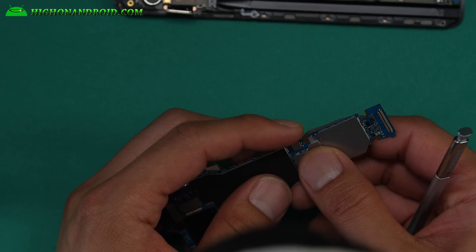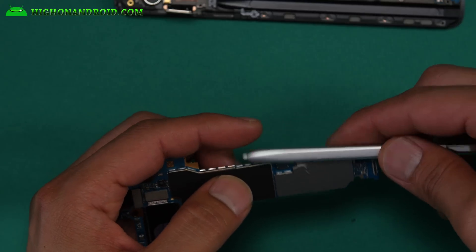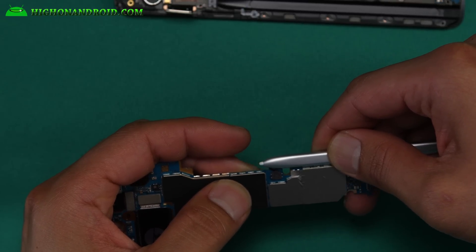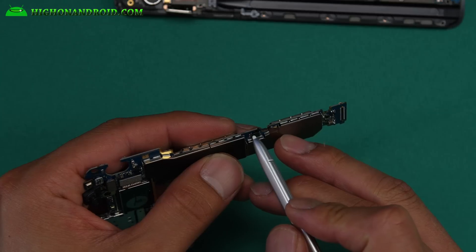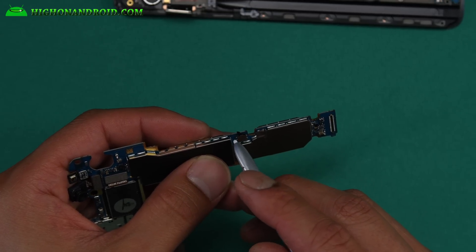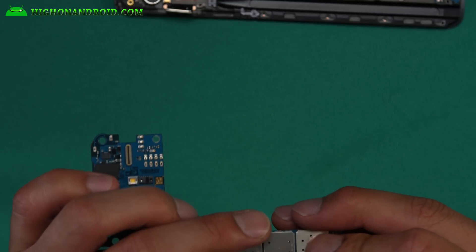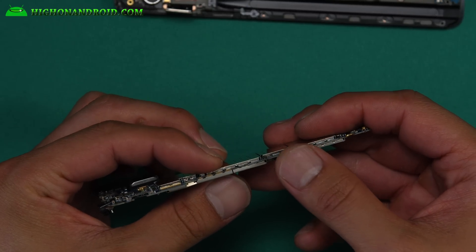This thing seems to be working, but when I have it inserted, it's supposed to hit that knob and pull it out, but it doesn't work. I'm pushing in — and when pulling out, it should pull all the way back, but it gets stuck in the middle. An easy fix would be to reattach that knob using super glue. It's not supposed to go all the way down past this point. There's really no way to fix this other than take it all apart and unsolder the part — and it's just a small part that can break so easily. I can't believe they did this with the major feature of the Note.